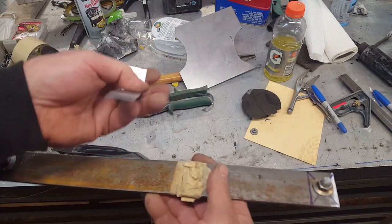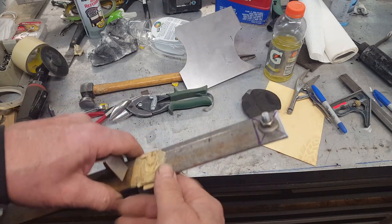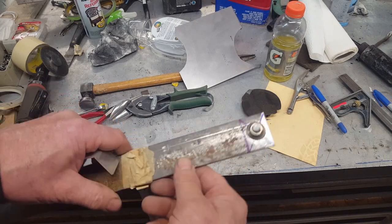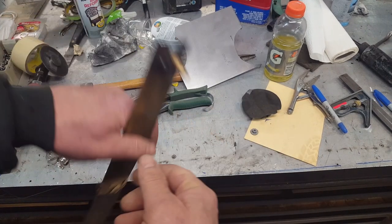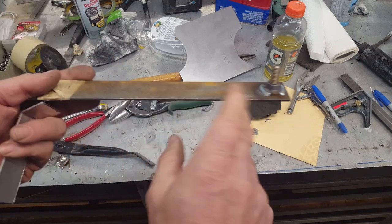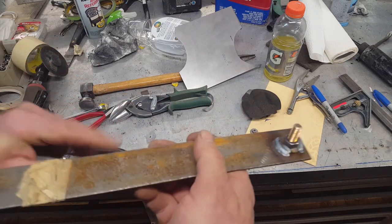And basically there's not a lot of control of the piece because, number one, it's small and it's got an angle bent into it. So planning ahead, I know where I want the hole relative to the end of the bracket and where the bracket's going to be. So it's going to be centered up there. So I'll go ahead and drill it out, and then, like on this side here, go ahead and weld up the capture nut on the other side. So what this does is now that this is welded up, now I can cut it to size, or even better yet, since this is such a thick material, I want to bend this in the vise.